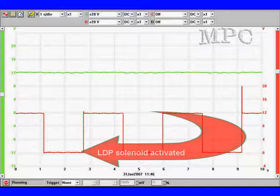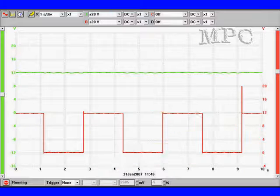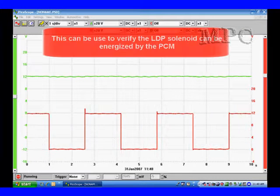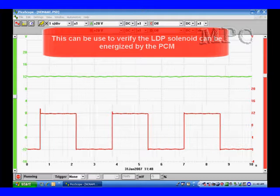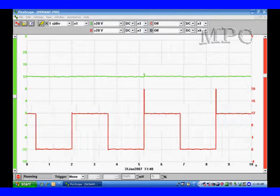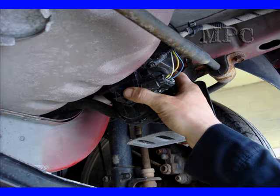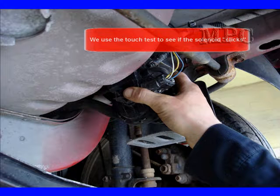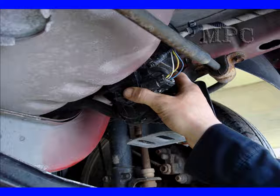When the solenoid is grounded — which is what we used our jumper lead to do — we can activate the solenoid. Here's actual film of it moving. This is what you're going to see on your scope to verify what the solenoid is doing. We're going to use the field test — actually go into the car, put our hands on it, and see if it clicks. We call this the click test. If the solenoid is clicking, we have it activated. The actuator test mode tells if the solenoid is working, but it does not tell us if it pulls a vacuum.